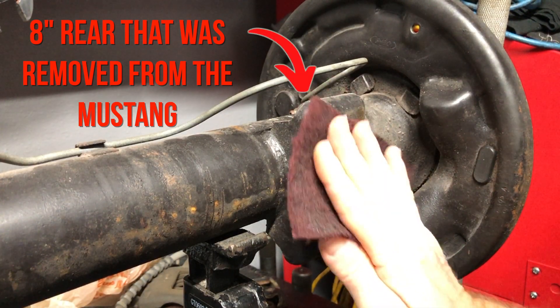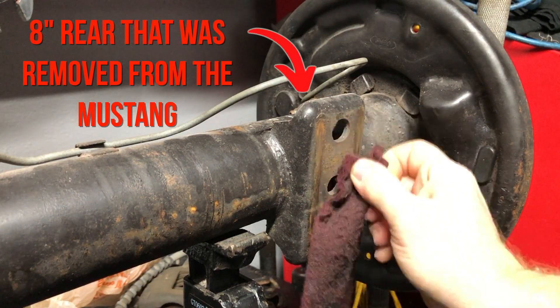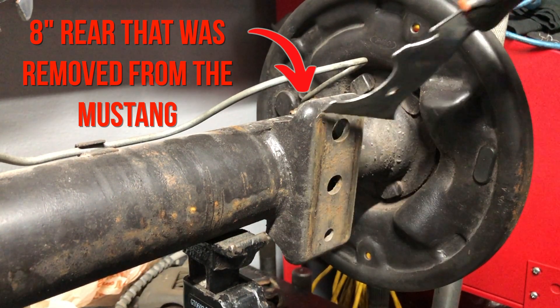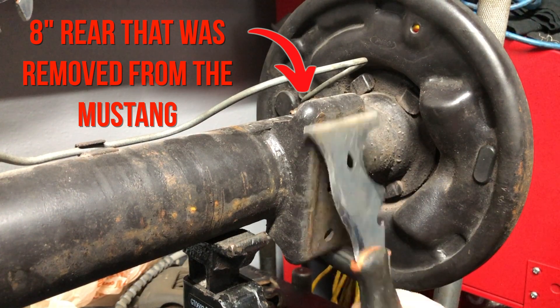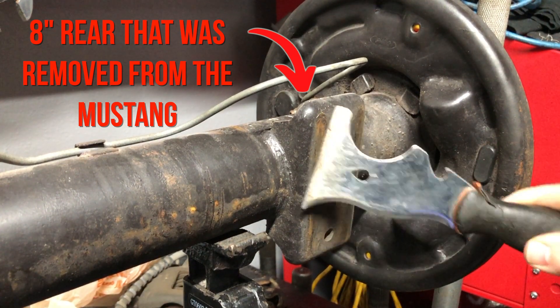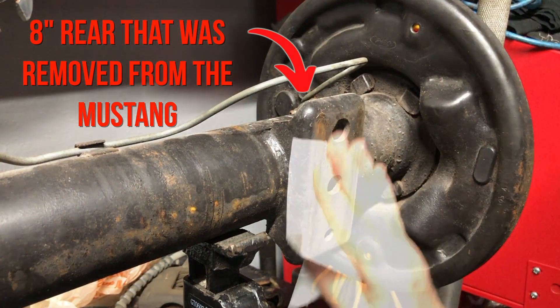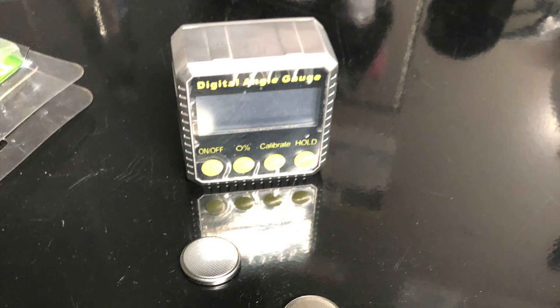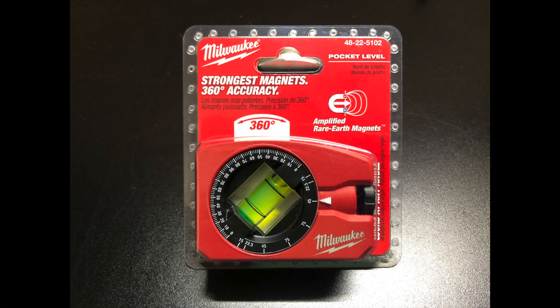Now that I have it narrowed and ready to go, I figured I'd use the old rear end to clean off the perch and find the right angle and location for the new perch. I use the angle finder to find the pinion angle — there are several you can use, and I will add a link to these two in the description below.